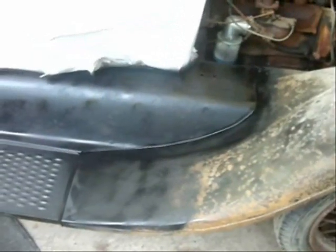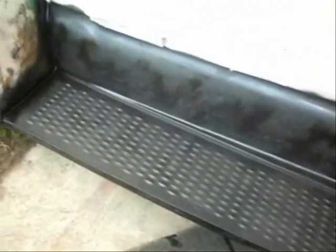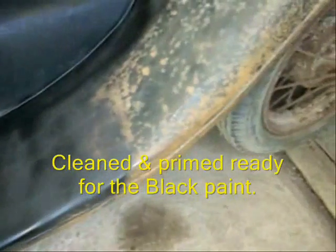Okay, I've got it primed out with that black zero rust. This guy's got quite a bit of pitting. Closer you get to the ground, more pitting we've got. The fenders are somewhat pitted back in this area, back in here. So I went over it a little bit, filled it a little bit. And then eventually it'll fill in best as it's going to be.